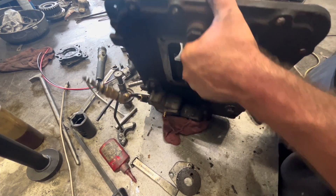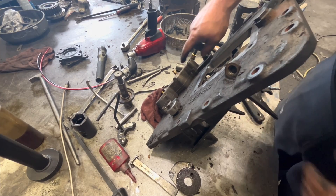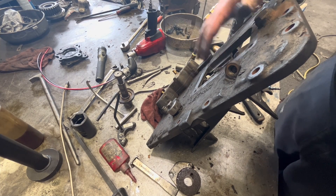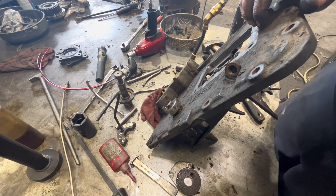The rust in this top plate is caused by the introduction of water into the air system. Also, another little fun thing we're going to do — I'm going to put this old modulator on a brand new top plate once I build the plate, and we'll see if there's anything wrong with this modulator.